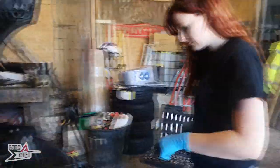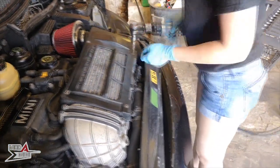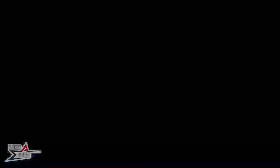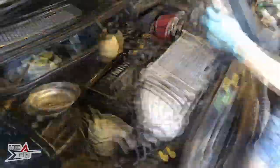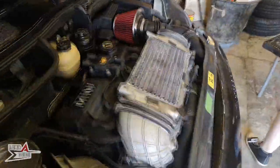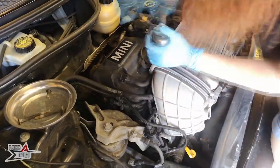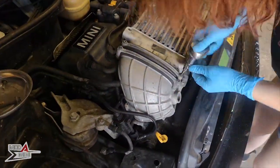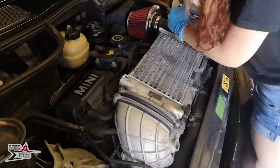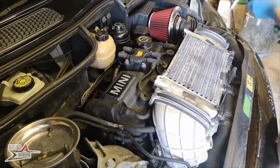Welcome to the engine bay. The first job, which was pretty much the only job I was trusted with at this stage, was to take out the intercooler by taking off the cover. Obviously this cover is broken and I personally refuse to put it back on because it's the only thing you can see, so I've celebrated once it was off by throwing it on the floor. Next you want to undo the four clamps either side - if you are using power tools, you need to make sure that you loosen them off with a manual ratchet first, as power tools can strip the head.